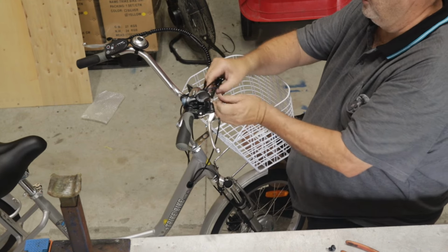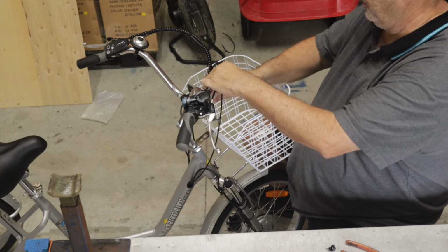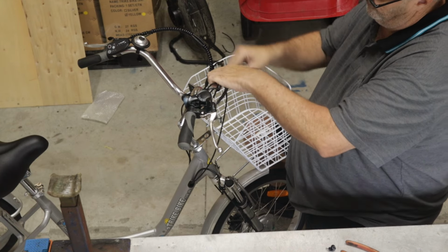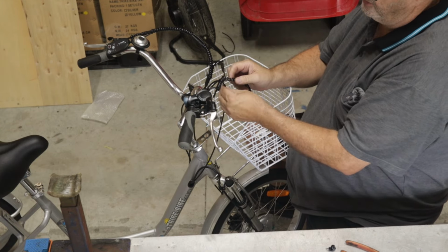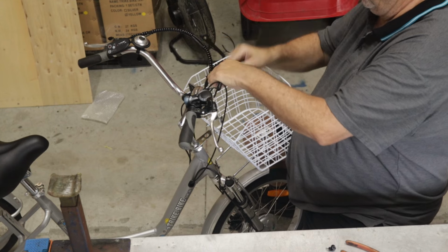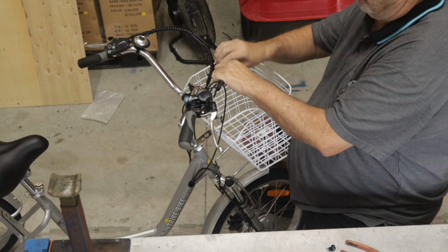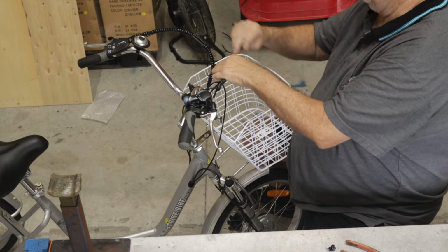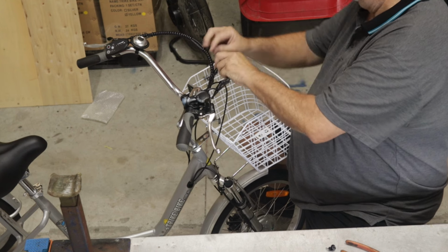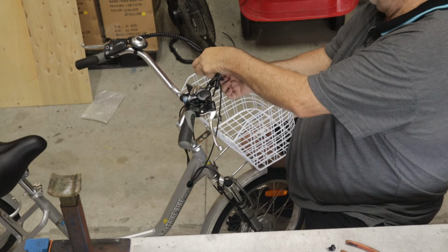So I've gone from 3 back to 2 cables, because the gear cable is heading up there. I don't want to stress it at all. And I'm going to drop the gear change cable out of this harness. So I've gone just 3 or 4 turns with the gear change cable in this spiral wrap. And again, if I go too far here, I'm going to end up stressing the connector, so I'm going to drop back to one cable. Take it down. Lovely.